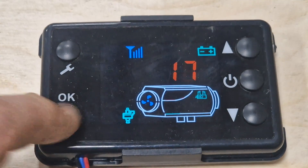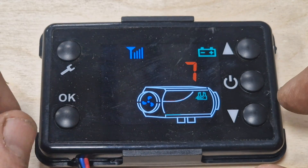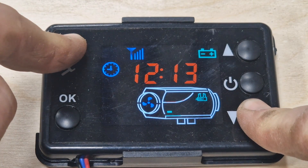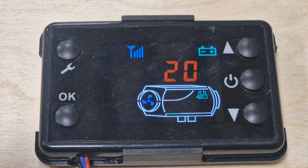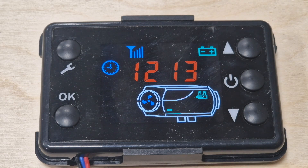I'm going to stop that because mine's already there. If you draw too much, fuel starts to leak out — you don't really want that. If you don't draw enough, the thing won't start up properly and it will lead to one of the error codes. If you get to zero and want to go again, just press spanner and down again and it will default to 20 seconds. Press okay to start, okay to stop, then the on/off button to exit.